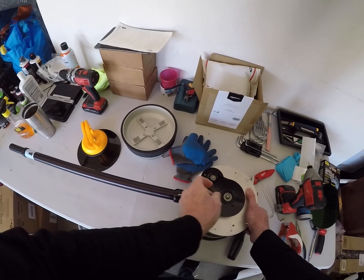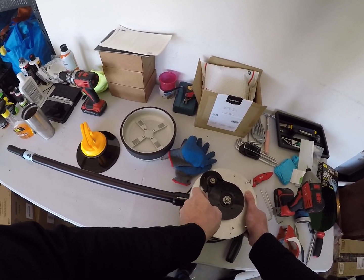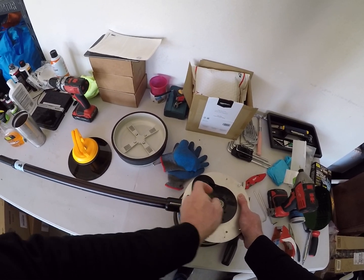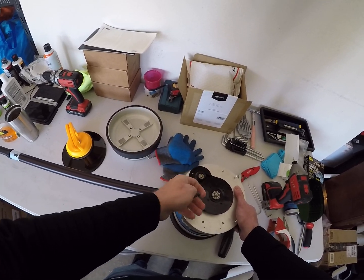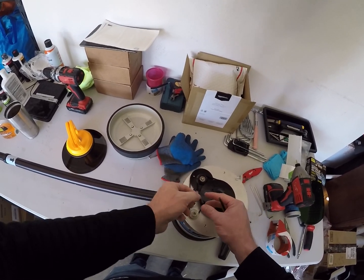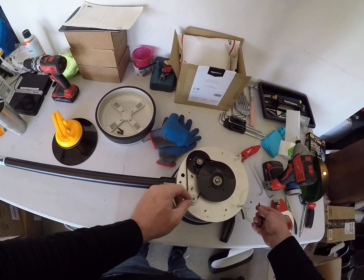Maintenance means making sure you don't ever let the battery run below a certain critical level, because if it gets below that level a safety mechanism gets triggered on the battery so you're no longer able to recharge it. These use custom-built lithium-ion batteries from Inspired Energy in Florida.